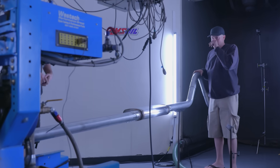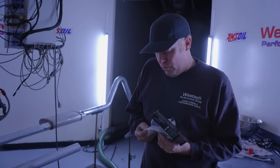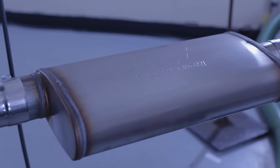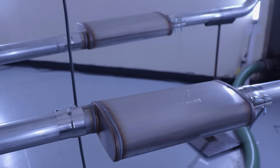This has to make it better. We took off the 2.5-inch exhaust and we're throwing the 3-inch on right now — we're looking to find our 620 horsepower again. We wanted to put an O2 sensor in the exhaust so we could see if the air-fuel ratio changes with the different exhaust sizes, but rather than welding, we're using a clamp-on oxygen sensor band with a little gasket so you can install an oxygen sensor without welding. We're using Magnaflow stainless steel mufflers — they are straight all the way through, no obstructions, no chambers, no baffles, just a perforated core and some packing. In fact, this test would be more dramatic if we used a bad muffler — these are pretty good.